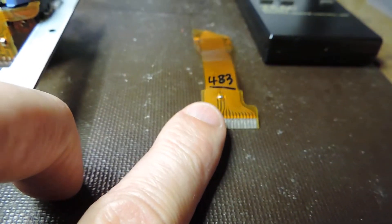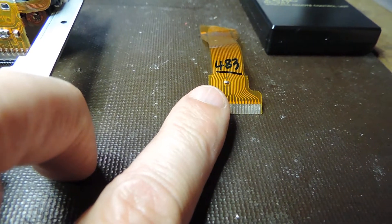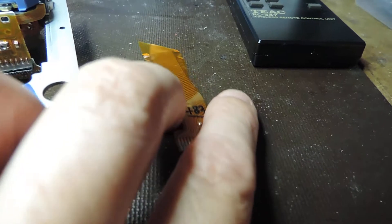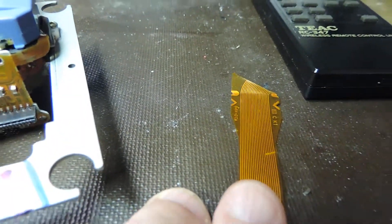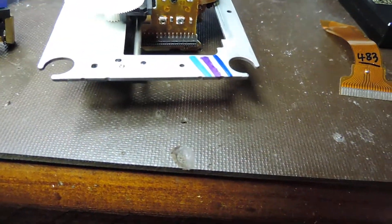On the KSS 151A, the shorting link is right here on the ribbon. People who installed this $400 mechanism didn't know that. And of course it did work at first, but later they rerouted the cable wrong and tore it away — so they ruined the $400 mechanism.